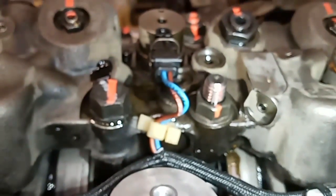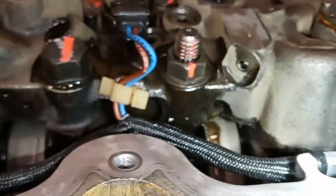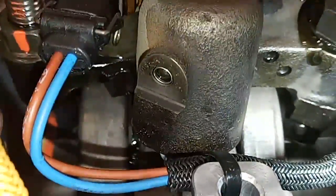This is quarts, not gallons, folks — so don't freak out. What it's going to do is push oil everywhere throughout the engine that oil is supplied to. You can actually see the IVA housings purging with oil. It's going to push all the old oil, dirt, and anything in this engine out, and when the engine starts it's going to have oil pressure immediately. This will also pre-fill the oil filter, so it'll have both oil pressure and fuel pressure right away.